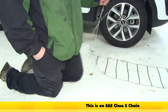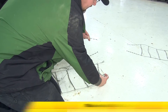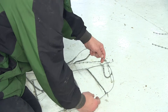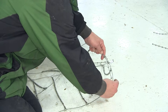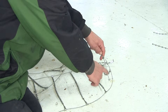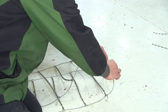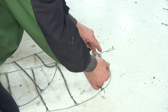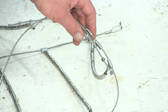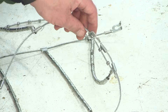With our cable chain laid out, one end has the adjustable notches. These notches will go into the eyelet on the other end, taking up as much slack as possible. If we have enough, the cable will lap over and go through the cable keeper, where it will get secured so that the excess doesn't flap around and potentially damage the brake line or wiring going to the caliper. If you do not have enough length to reach the cable keeper, you can trim it right behind the notches to prevent fraying, setting it up for this specific vehicle and tire size as necessary.